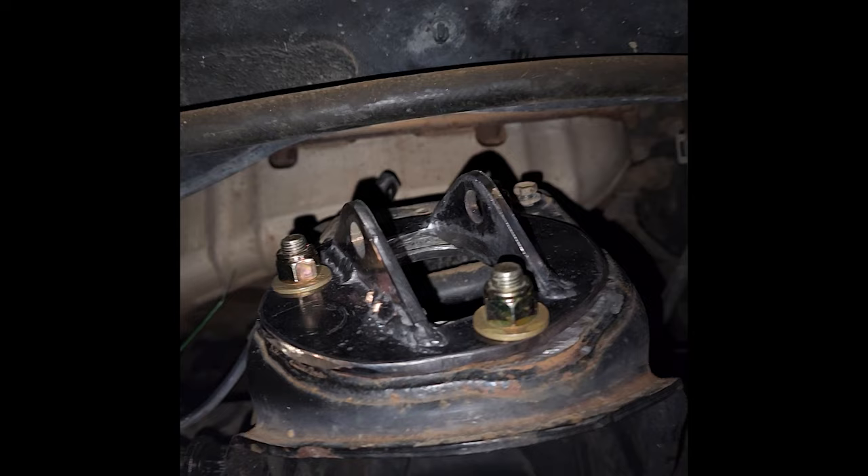This is what happened to my upper shock mounts after I took it on a shakedown run at the Oceano Dunes. I quickly realized there's a reason they mount them upside down traditionally on the kits you see for sale. I had to hit it with a big bead of weld and now it's fine — it held up to Rubicon no problem. I'm just glad I took it on that shakedown run first.